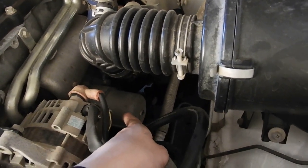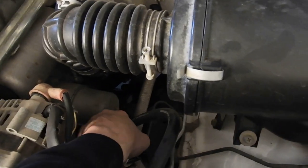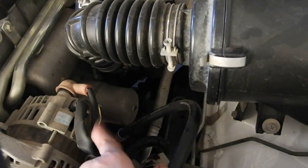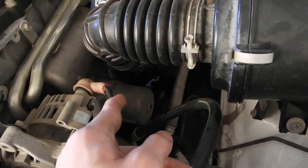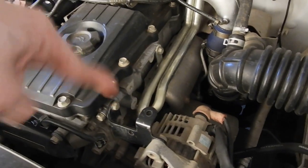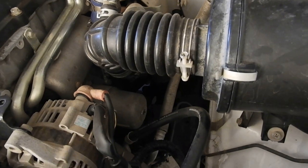So, the piece that you guys are going to have to undo is that piece there. So, that is the casing for the filter. There's a little notch in here, so I'm just going to put my, I think it's my quarter inch into that. Sorry, not my quarter inch, my half inch drive. And that's just going to break it, and then I'll just twist it by hand for the rest of the way. We'll take out the filter, and we're going to let all that drip down into the drain pans below. We'll pour some water through before we do that, though, just to make sure that I know where to put the bucket.